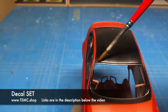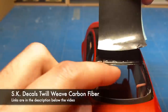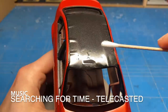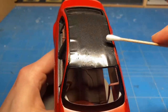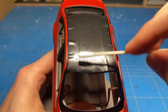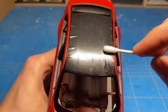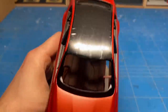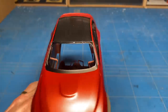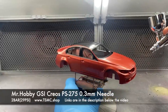As you probably all know, these M3s have a full carbon roof. The small strips on the side need to stay gloss black, so it's just that center section that needs to be done in carbon fiber. For this one, I decided to go with some SK decals twill weave carbon fiber. This decal is a little bit thicker but also works a little bit more like vinyl — it stretches a little bit and doesn't really require all that much softening solution. First I laid some setting solution underneath to help it stick and soften it just a little bit, then carefully rolled over it with a cotton swab to remove all the moisture and air from underneath. Once that was done, I could heat it up a little bit and do the final shaping. If you want to know more about carbon fiber decal or decal placement in general, there are multiple tutorials on the channel, so feel free to check those out as well.